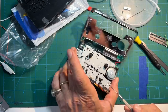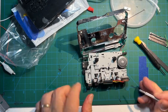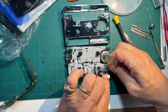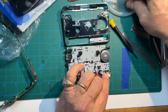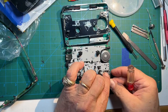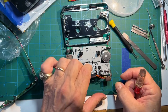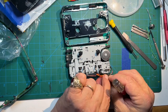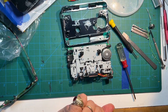The idea is to expose the little switch in the lower right corner of the cassette area. It doesn't look much like a switch because the part you push is pointed down into the mechanism, so it can swap tracks when you press the tiny button to reverse or when it reaches the end of the tape. Its function is to switch to the other tracks when the tape mechanism changes direction.